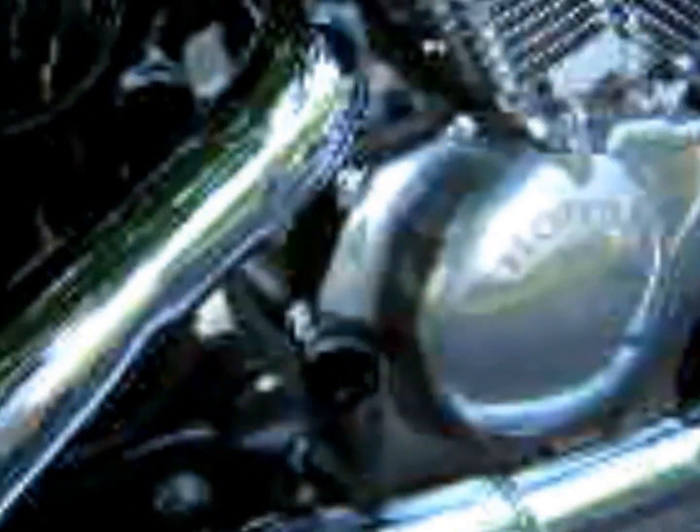One other thing is the oil filter has some oil in it, so you want to fill it up and then run the bike for about 30 seconds, and then check the oil again, and you'll see that it'll drop quite a bit because the filter definitely holds some oil. So make sure you do that as well. Don't overfill it, or it'll spray out onto the air filter.